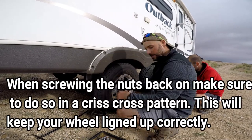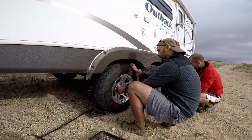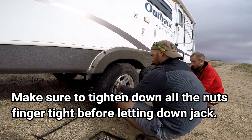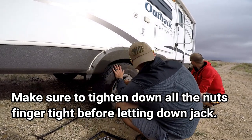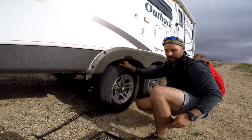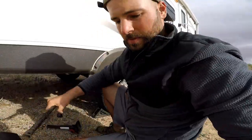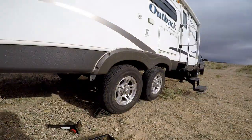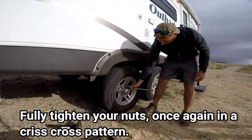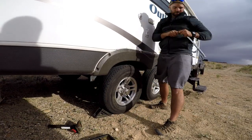When you put your nuts back on, make sure to do it in a crisscross pattern — kind of like a star pattern — top first, then bottom, then left and right. Tighten them all down finger tight before you let the jack down. The whole purpose of doing this is to keep your tire lined up when it presses against the drum, so you don't strip any of your screws out. Especially if you're using an air tool, make sure and finger tighten these nuts beforehand. Once you have your jacks down you can go ahead, put your socket on, and tighten everything all the way — again using that star pattern.